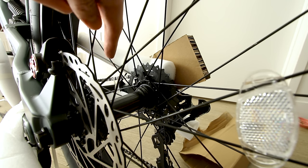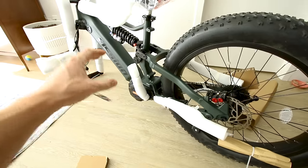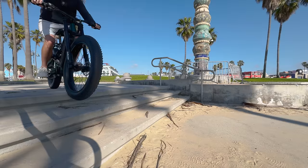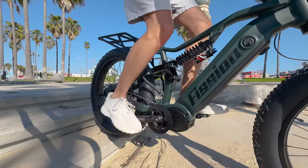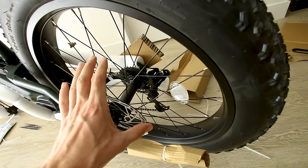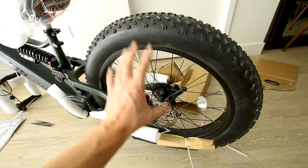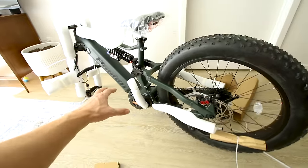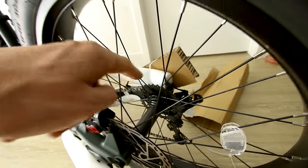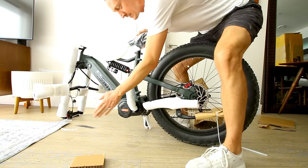When you have a mid-drive motor, there is no hub motor on the rear. Other than the torque of a mid-drive motor, one of the benefits is not having the weight on the rear — it is mounted down here, which gives you better handling characteristics. Since the motor is on the frame, it is sprung weight, giving you better performance compared to a hub drive motor that is unsprung weight — a big heavy weight inside the wheel bouncing around. Mid-drive is better for these things. Other benefits of the mid-drive: you send the power through the gears, so you can really maximize the benefits of the torque.